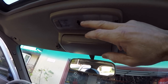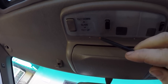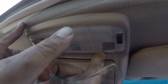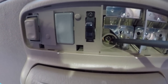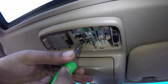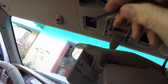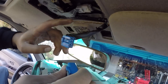Now we'll go for the dome light and the controls for the sunroof. There are little notches where you can get a slim tool to pull the lens out, so Mark's getting a small screwdriver in there to pry it off. He's got one side and then the other — there it is. You can see the light bulbs, switches, and a big Phillips head screw to remove to get it down. It looks like it comes down by pulling towards the back of the truck. He's going to disconnect the electrical connector, and now that whole assembly is free.